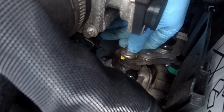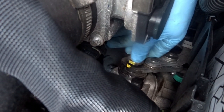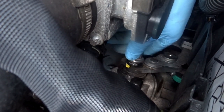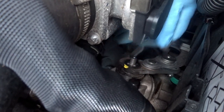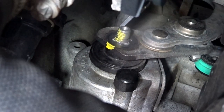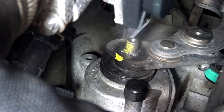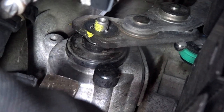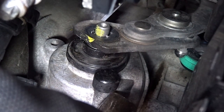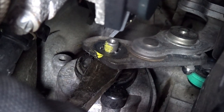We're just going to move that by hand. We've got that nut somewhere safe. With a little bit of nail varnish we've just marked the threads on here so that when we replace this we know roughly how that's going to go on. Our next job is to prise off the gear linkage. We're going to be careful because there's this little plastic rubber bit — it looks like a breather of some sort — so we're just going to be careful not to damage that, and underneath here we're just going to lift this up.